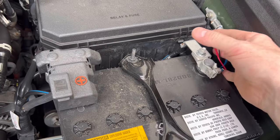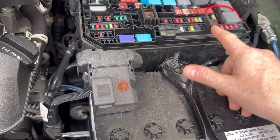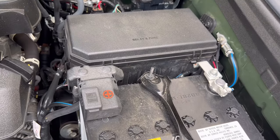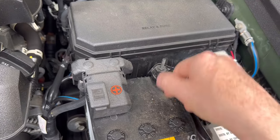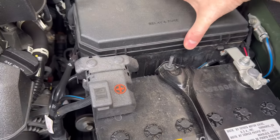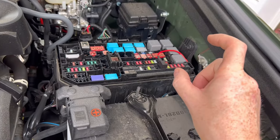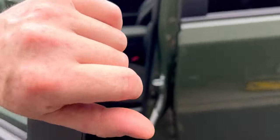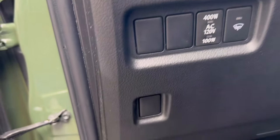Currently I have a straight ground with this wire, and when you remove the box there's a fuse right there — but my box doesn't even close because the fuse doesn't let it. I want to remind you that you definitely don't want moisture entering the fuse block. I managed to smash my finger during this, but we're going to fix that today. We're going to run wires inside, add a relay in between, and a switch on the inside of the car — most likely going on one of these spots right here.